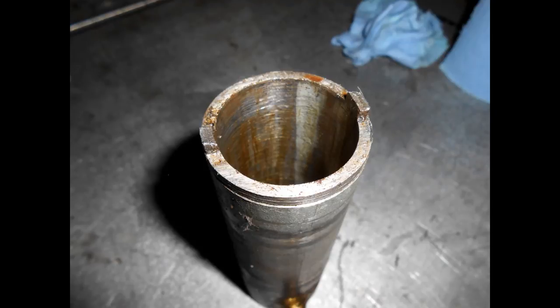And here you can see the two notches that fit down into the collar at the bottom of the fork seal holder. I made this one on the mill, but you could just as easily cut them out and file them. So, hacksaw and a file job. Again, an easy tool, and it saves you having to try and grip the actual fork seal holder from the outside, because they are chrome and you can make a mess of them. Anyway, there you go.